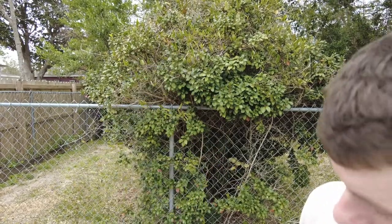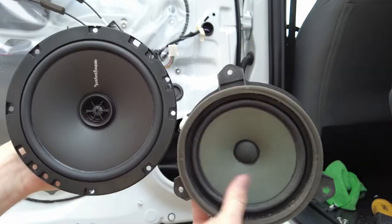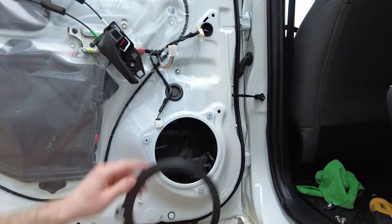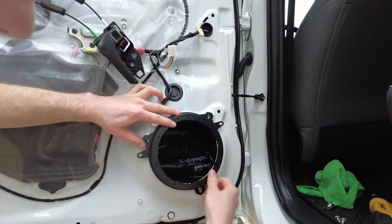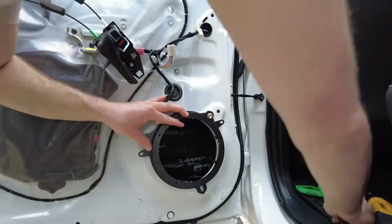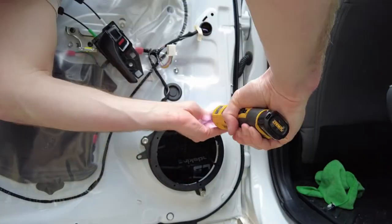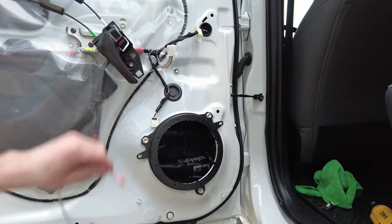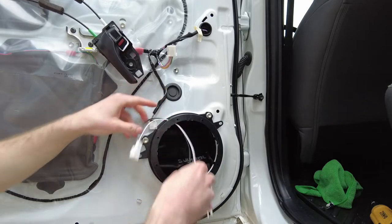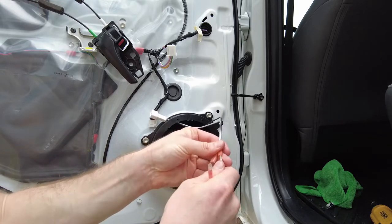A little comparison here — as you can tell, it's just a complete difference. I mean it's just a huge difference in quality. So I'm going to go ahead and trash that one. Here's our adapter — look at all three holes, you can see they line up. I'll have this adapter in the description below so you can have the exact same setup. Now you want to go ahead and feed the wire through this tiny little hole. For some reason Toyota has the wires outside of the speaker — actually it's pretty nice, this is the first time I've seen that. Match the small one and small one here.